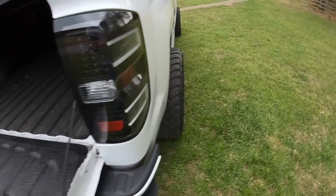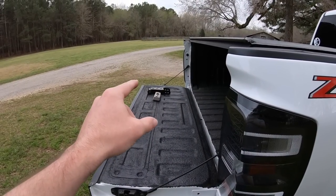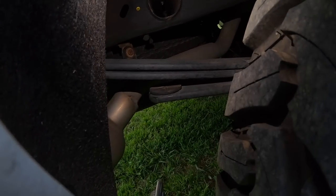No different there. Now the next option that people do, because a lot of people want a really squatted truck, they'll do the no block, the drop shackle, and then it's still not enough, so they go in here and take out the extra leaf spring, the helper leaf, or whatever you want to call it. Different trucks will have different amounts of leaf springs or different sizes, but as you can see, that one has the little pad there and it's not touching. So when the truck gets loaded, it goes down onto that, and that supplies some extra weight dispersion. It's an extra leaf spring, so you can haul more weight. People will take that out as well, and that gives you that much more drop. So that's pretty much, as far as I know, the three real big main ways.